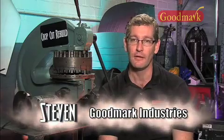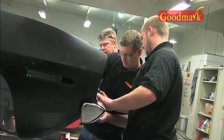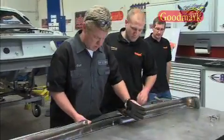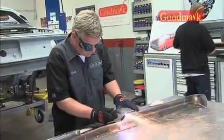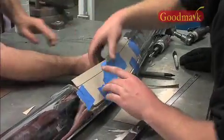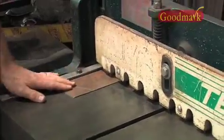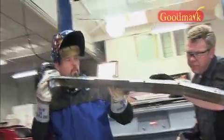He's going for a more cleaned-up look across the front. While it still uses the stock components, it'll be a little tighter and cleaner looking. We also removed the license plate pocket on the bumper and filled that in. We're being allowed to flex our muscle and put our signature on this car — all cars that I build are like my children, and each one has its own inherent signature. We start with a templating board and tape, get the initial shape, find the radiuses needed, convert that to metal, shape it, tack weld it all into place, and shave it down to where it looks smooth enough to body work it.